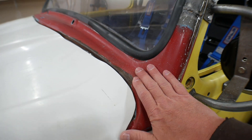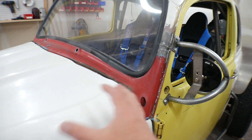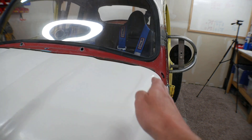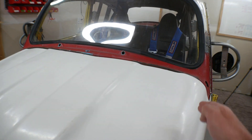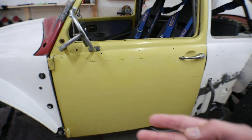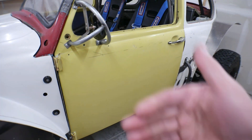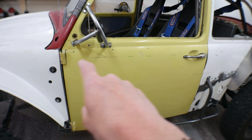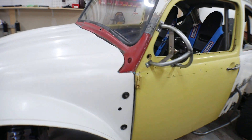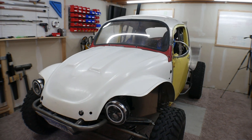But I'm going to modify the Ratchet chassis around here because I want to keep this rounded look. I don't know exactly how I'm going to do that yet, but I think I'm going to take all of these skins, put them in place to mock the pieces, and then where I need to customize the chassis I'll just use my bender and my roller to make the tubing come right up to the metal and fit in there. I'm also going to give Mauler operational doors — not full-sized doors, but I think they will open, and instead of a bar running straight across, I'll have a cross so it's much easier to hop in.